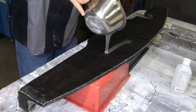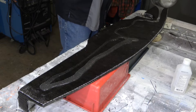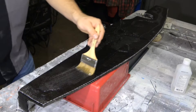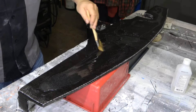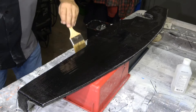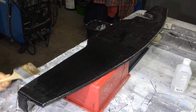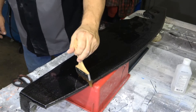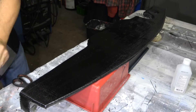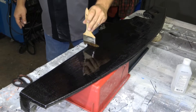Next pour on your first coat while it's still sticky underneath, because this is going to wet the carbon fiber and make it stick to the surface. Use the brush lightly — spread the epoxy out very gently, making sure you get the entire surface and around the edges as well. Don't worry if it drips off the edge, just make sure you get full coverage. Then lightly drag the brush over the surface to even it out. It's going to flow over a couple of hours, so drag it really slow — this will get rid of a majority of the bubbles.